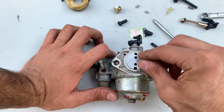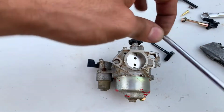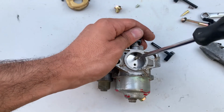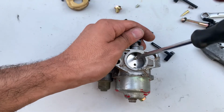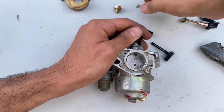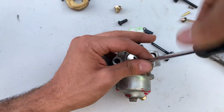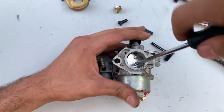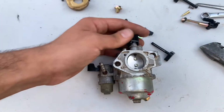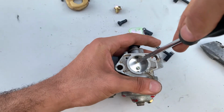That's a brand new accelerator plate or throttle plate or whatever, and it did come with brand new screws, so I went ahead and installed the new screws. That had like some locking washers is what I had on it. Snug those down, not too hard, don't want to strip it out. Make sure to leave them kind of loose and move the throttle to the fully closed position so the plate will seat correctly in there. Here I loosened mine up so I could correctly align it.